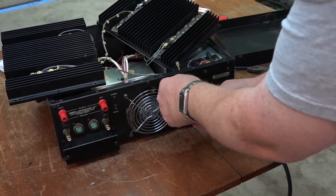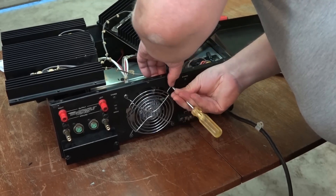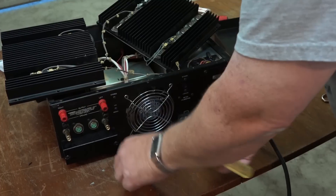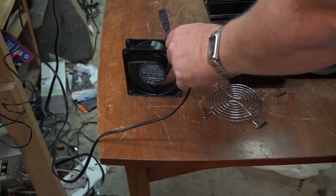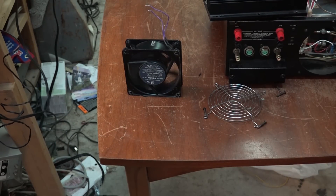To take out the fan I just have to remove these screws — there'll be nuts on the back side — so I just need to remove the four screws and then I can remove the fan and install the new fan. By comparison you can see how loud the old fan was, and it really doesn't provide that much more airflow than the new one I'm putting in. This is why people disconnected those fans — they were exceptionally loud. It's fine in a nightclub or professional application with music pounding, but completely unacceptable in a quiet living room. The fan is configured as a pressurizing unit, blowing air in, so we're going to orient the new fan so that air is going into the cabinet.